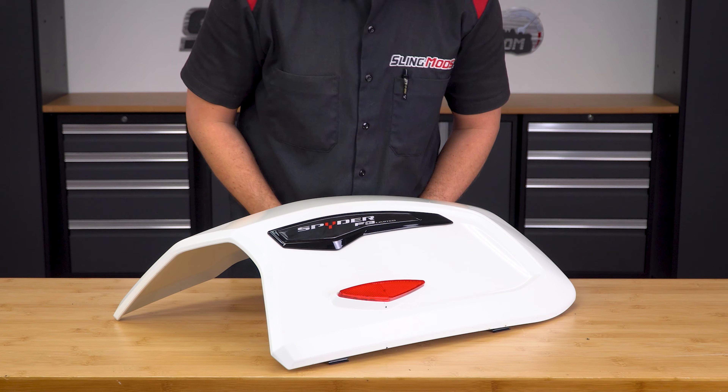Plug in the new OE style harness from the kit. Then crimp on bullet connectors to both ends of the black and white wires of your LED. Add a dab of dielectric grease and plug in the black bullet connector to the black wire on the OE style harness, and then the white wire to the orange wire on the new harness. Disregard the three remaining female bullet connectors since those will not be used in this application — go ahead and wrap those with some electrical tape. Bundle up all excess wire, leaving a little bit of slack for the small white plug at the bottom.